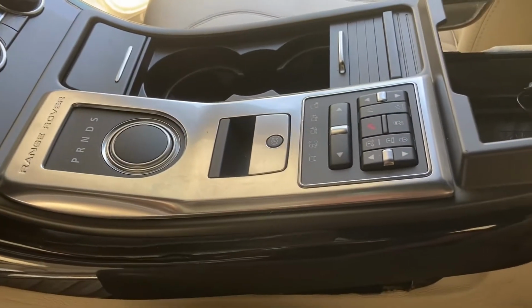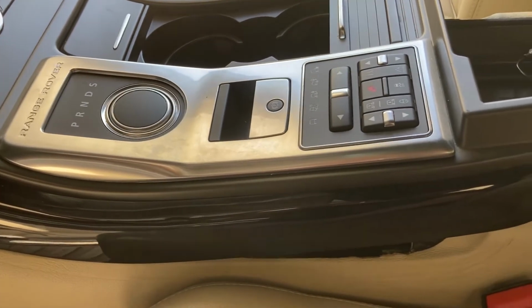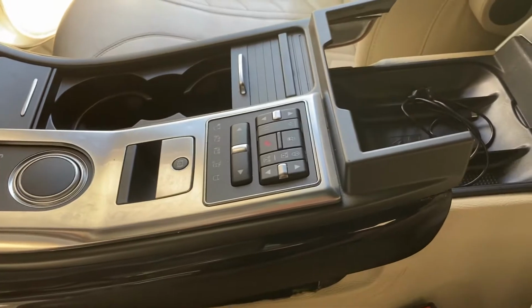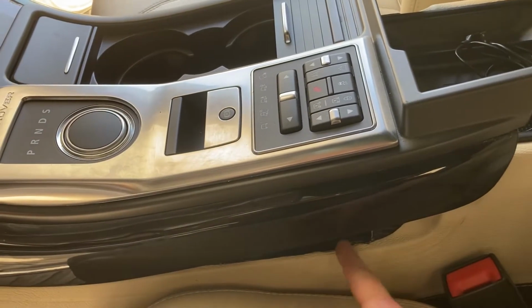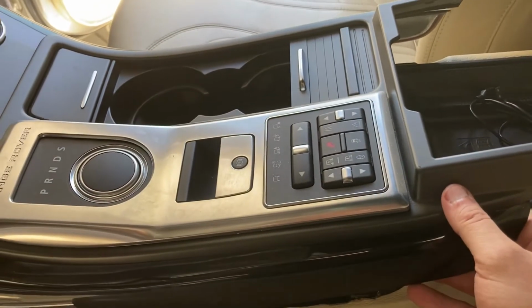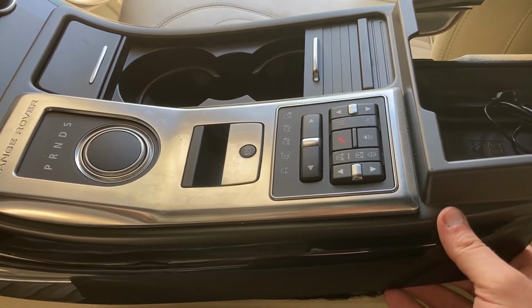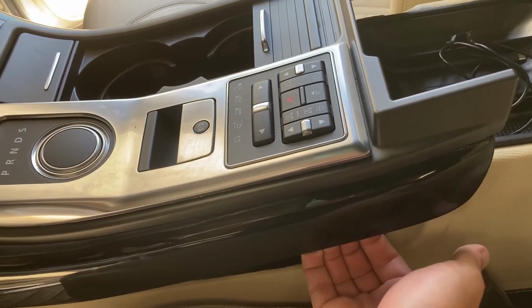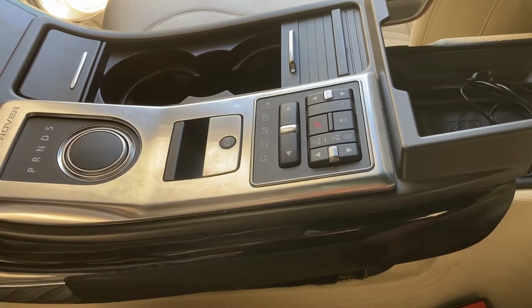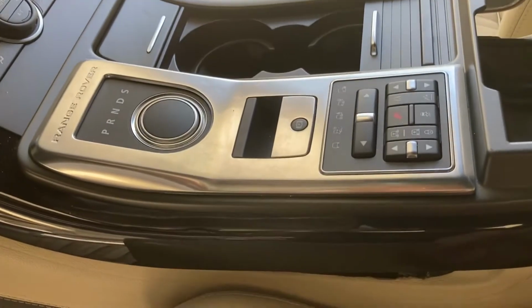And then the center console piece itself is held together with a number of fairly strong clips, so no screws unfortunately, and you basically have to struggle with it for a while to make it unclip from the bottom here. It took me a while to do this. It works eventually. Those plastic tools also come in handy. You can maybe put them beneath here and push. That helped me as well. But eventually it should come out. And this is how it's supposed to look like.